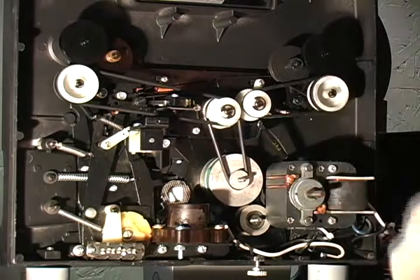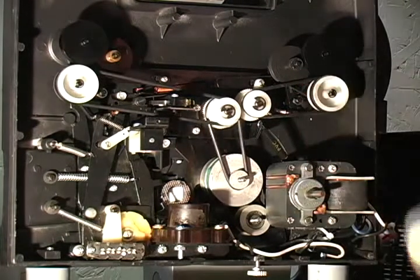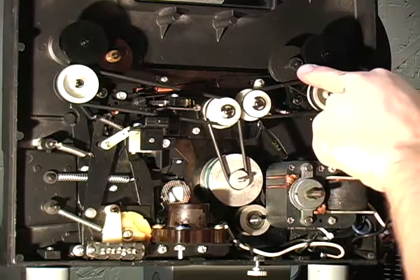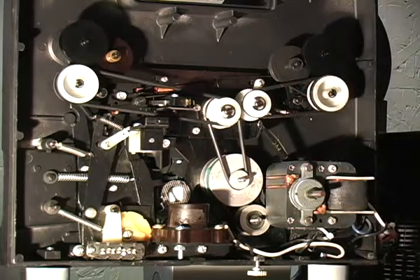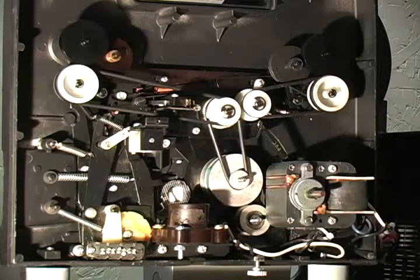There are also small little belts back here as well. The other thing is this rubber tire up here — that's another thing that usually goes. If you're just getting an old projector that hasn't been used for years, it's usually dry rotted. You can pull that off and get a new rubber tire as well. It slips on and off — just take a flat-headed screwdriver or a little pointed file, get behind it and pull forward and it'll come right off. That's really all you need to worry about back here with all these pulleys. I know it looks confusing, but it really is a simple design.